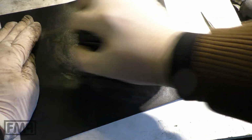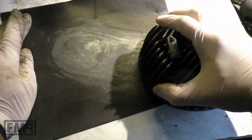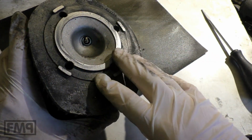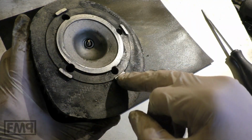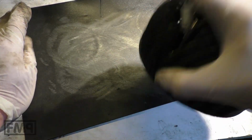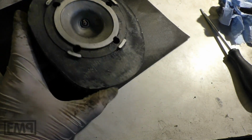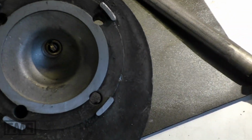And I mean, original engines, yeah, Piaggio, they had nothing special. Most of them have it. It works. It is a tractor engine, but it's not good at all. Because you see they're also pretty high, and when the head gets hot, cast material expands, and this doesn't work very well when you have these 4 beams. You remove them, then sandpaper it, and you're good. It will be tight. Of course, use sealing mass for it, and everything will be fine. Of course, I'm gonna sandpaper it again after removing these beams. See ya. Cheers, guys.